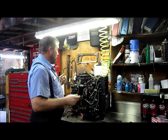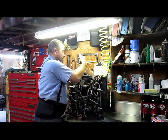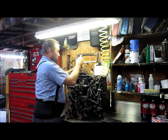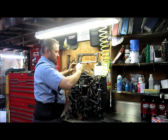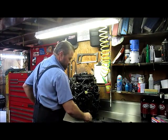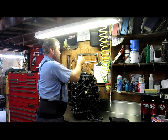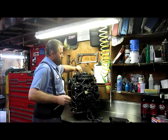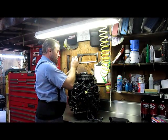The most important part of rebuilding an engine is organization — keeping everything organized, keeping your parts separated, making sure you get all the parts into the right bag and label it accordingly. That really helps a lot when you go to put it back together. I've done hundreds of these so I don't need to be as organized as most people should be, because I can tell what goes where, but still keep it as organized as possible.